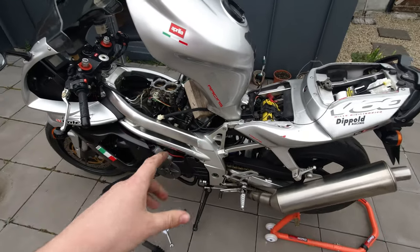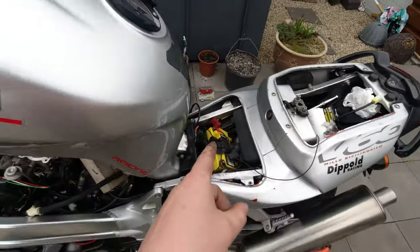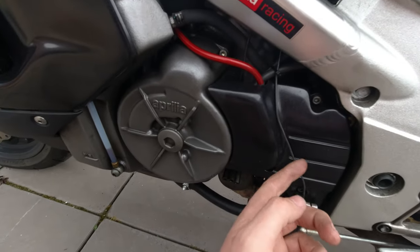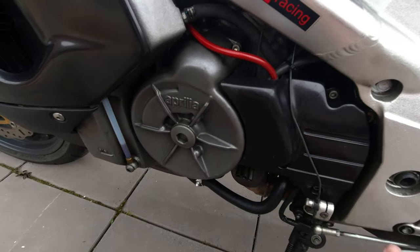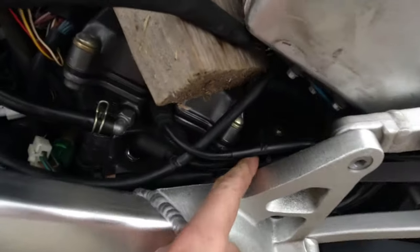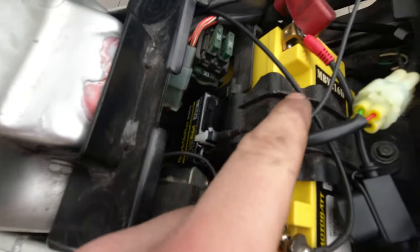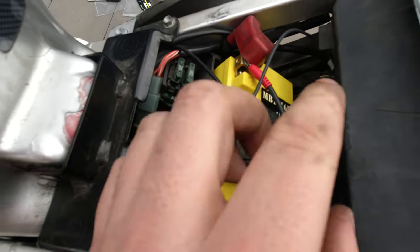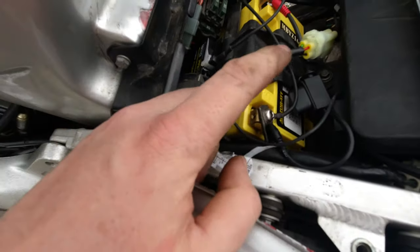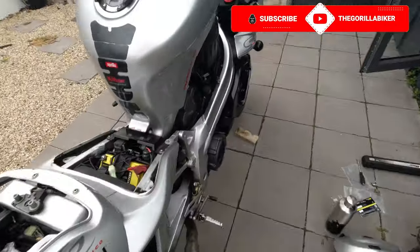So I'm going to tidy all this up and stick this in place. It's kind of cable tied there — I'm not overly happy with it yet, I might have to move it a little bit, but it's okay for now. It's also cable tied here — that's the quick shifter cable itself. There's the plug for the main unit; again not ideal, all over the battery — I might move this eventually. And then I have the earth or ground going directly to the negative of the battery.